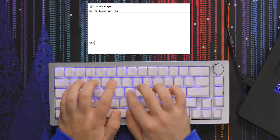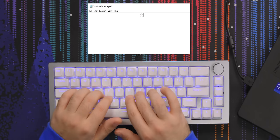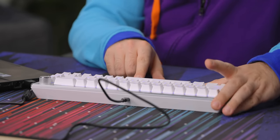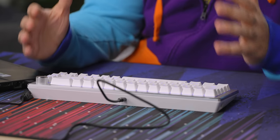Honestly, it feels and sounds okay. The spacebar is definitely apparent, but that's actually really hard. Something a lot of people complain about is that the spacebar is going to sound really different from the rest of your board. Part of the problem is that it's just a much larger key — usually about 6.5 or 7 units, versus like one, two, or three on your enter and backspace. It's really easy to make the other keys sound good when it's just a three-unit stabilizer, but once you're going all the way across with that really long bar, it's hard to make it sound good. You could probably improve this with a bit of foam under the spacebar itself. Maybe just screw in the stabilizers — it's a lot easier for manufacturers to just clip stuff in, I guess.